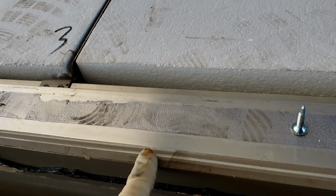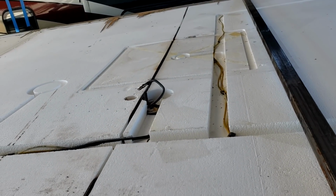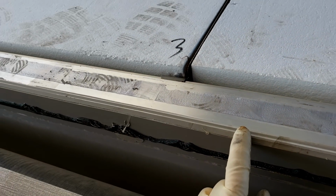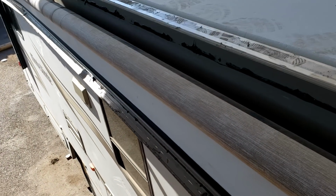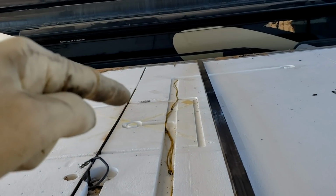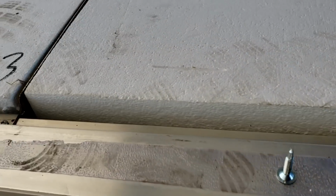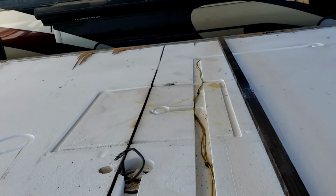So from the outside to the outside there is about 8 foot 4 inches, and it's really difficult to find Luan paneling in any lengths greater than 8 feet. But from the inside here to the inside of that one, we're looking at, I think, 7 foot 10 inches. So if we go, I made a mark somewhere over there. So right about here, and the same amount on that side is 8 foot exactly.